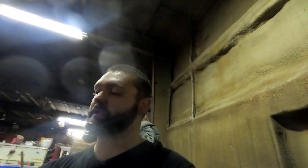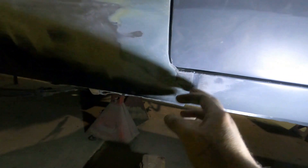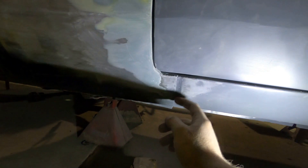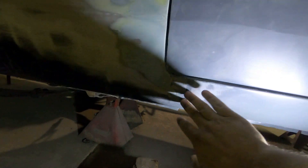Hey guys, welcome back. We're continuing a little bit of the body work on the charger. A lot of this you guys aren't going to see just because body work is extremely boring — it's just a lot of sanding, and I'm not a bondo guy, so it is a ton of sanding. One thing we're going to do with the car is get rid of a few body lines that I don't like. This is one of them where the rocker meets the quarter. I'm just going to weld it, grind it, and then put a layer of filler going from here to here.